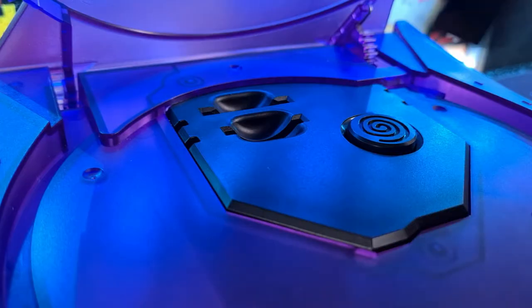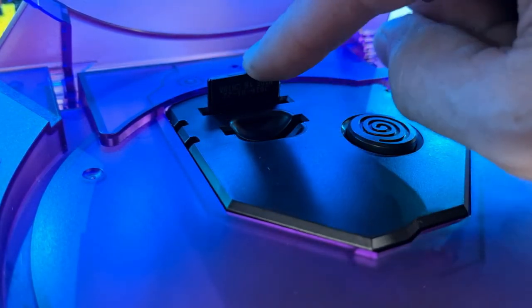This time, because I want to keep the noise to a minimum and cool it a lot better than the teeny weeny little squealy Dreamcast fan does, we're going to take that out and stick a five-volt Noctua fan in its place. It'll be so much quieter and will also increase airflow through the machine, preventing any overheating from all the modifications. Hopefully we'll get through this with minimum fuss.